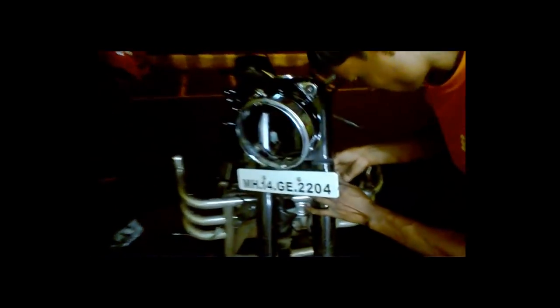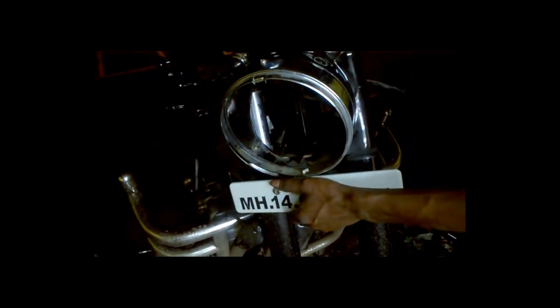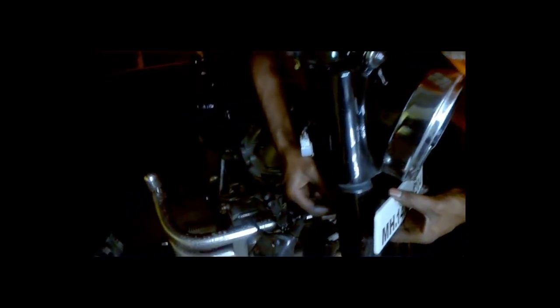As you can see, I've removed most of the material from the headstock — the dome is almost empty. All the wiring is completely disconnected. Don't worry about the wiring when disconnecting, because each and every connector has its own color code protocol. The company has given a color code to each connector so you can't join the wrong connector to the wrong socket. Now you have to focus on this assembly. Here is the Allen key socket to remove the top bolt and take out the fork assembly.